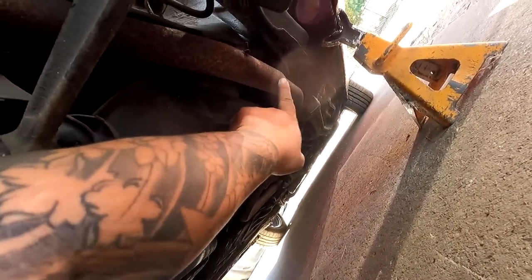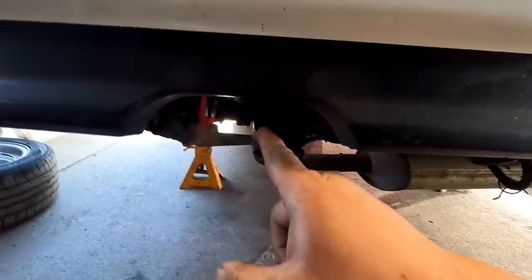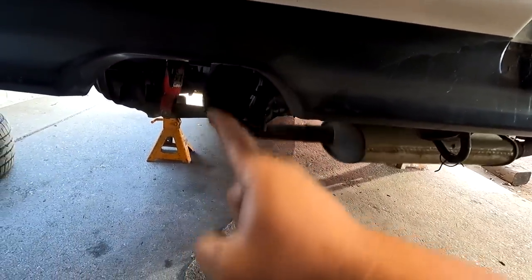And what I'm also noticing is that there's no flange here either. So where's that? This is aftermarket? Or, I mean, I don't know. It looks aftermarket because those hangers are welded over there. Okay, that's interesting. Oh, wow. Look at this. Holy cow. Okay, well, there's my exhaust leak. Okay, that makes sense, because I noticed that this is off-centered as well. Add that to the list.